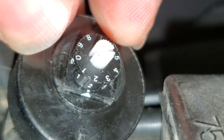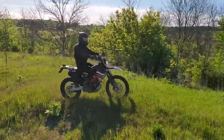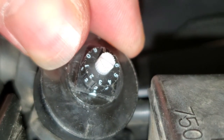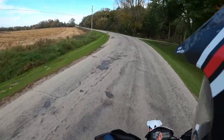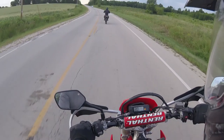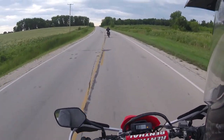Position 2 is considered advanced mode — it's the same as sport on the new models with a snappy throttle and power throughout the entire rev range. Finally, positions 3 through 9 all put the bike in standard mode. This might differ a little from street mode on the new models but the manual suggests they are the same. The way I can best describe this mode is it's like having VTEC on your bike: the power is nice and smooth but if you get on the throttle a bit, the bike really wakes up.